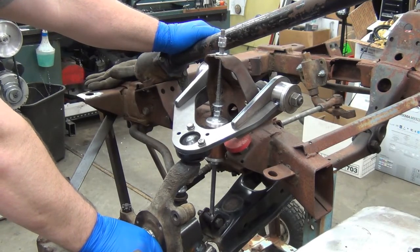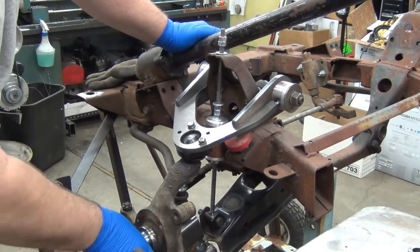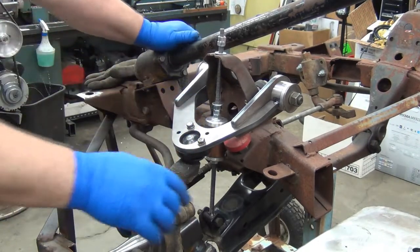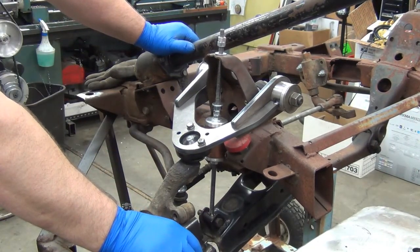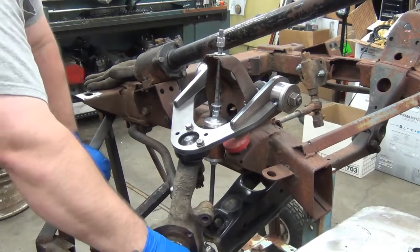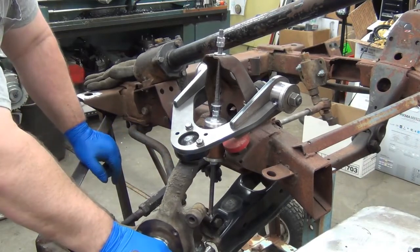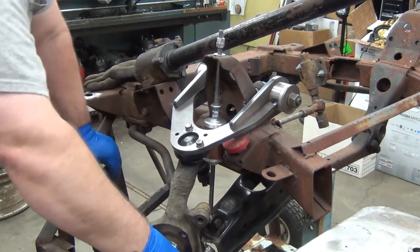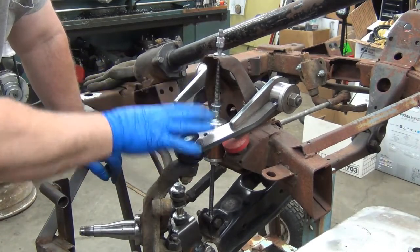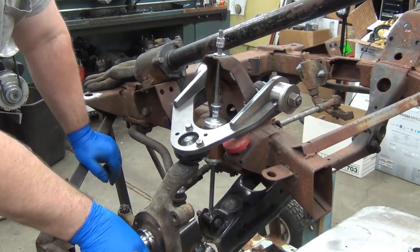Alright, well, with the lowered suspension, this is at full drop. Droop, probably more accurate. Okay, I'm not touching the bump stop, and I'm not bottomed out on the shock, okay? What it's hanging up on, I'm assuming at this point, it's hanging up on the ball joint travel. So, worry about that a little bit later. But anyway, with it all the way down, if I turn it, I can turn it all the way. Comes real close over here at the sway bar. But since this is going to have to be lifted up a little bit, that's going to gain a little more clearance anyway. So it'll go both directions without hitting. I'm against the steering stop, not against the bolt. It doesn't raise up or down when I'm turning back and forth. So I know it's not my tie rod ends this time binding up.